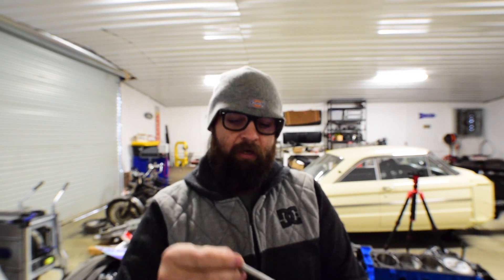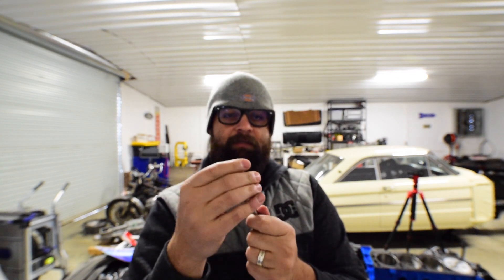So the plan is: I went through a big bucket of drill rod stock and found a drill rod size that fits the valve guide. I'm going to make a tool to notch that — it's a letter R drill guide, which is like 339 thousandths. I got onto McMaster-Carr and ordered a three-foot length; it's super cheap, about eight bucks. I'm going to make a tool with a collar that has an adjustable depth stop, then weld a flat disc onto it and use 80 grit abrasive. I'll use the cylinder head as basically a fixture and run a vacuum through the exhaust port with everything taped up so I don't get any shavings down into the engine. That's how I'm going to clearance those pistons.